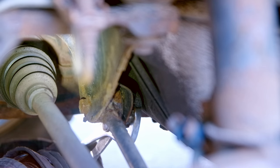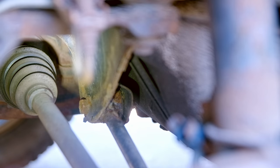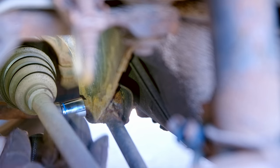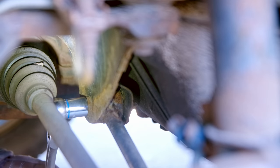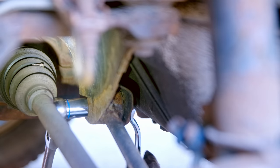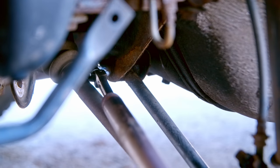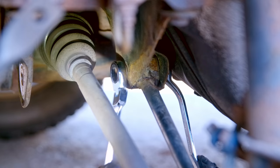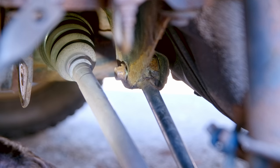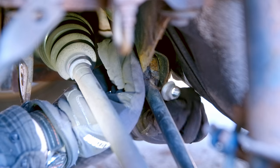Then on to the front arm — you have this little dust cover on there, and there's a little washer with some tabs on it behind it that it sort of walks onto, so make sure you put it in the right orientation when you put it back together. Then we need to slip a 17 millimeter socket on the head of the bolt, and it's really tight. You can remove the axle if you want to, but you really don't have to. I just used a thin ratchet with a shallow socket. You might have to jack the hub up to get the axle out of the way, but once you break the bolt free, you can use a ratcheting wrench to get the bolt loose the rest of the way and get that nut and washer off.